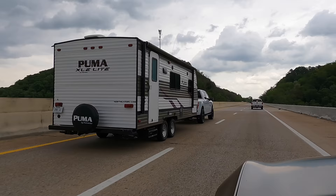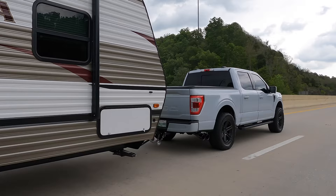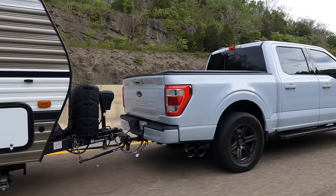Show them some footage of the trailer going down the road in the last video. The footage you're seeing here is the same camper, same setup, without the Roadmaster Active Suspension. You can see it's fairly level. In the video we shoot today, I expect it's going to be a little bit more level and we're going to have even less porpoising. I also want to see under hard braking if this can stop some of that axle wrap, because when you get on the brakes a little hard, it wants to wrap that axle and you get a little wheel hop coming up to a red light.